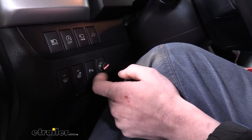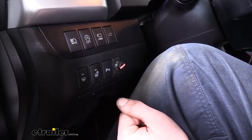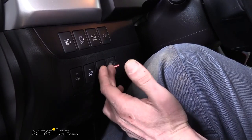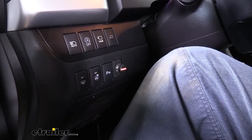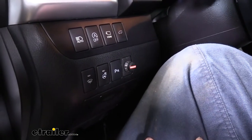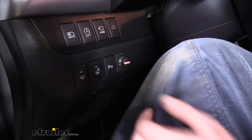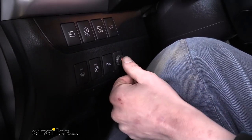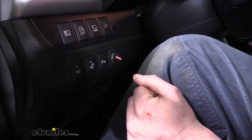It also has a second mode — a user control mode. This is similar to time delay, but it is Redarc's own specialized system. This is more for off-road applications because when you hit the brakes, they're going to apply at the back so you can dig into the mud and stop instead of sliding without really applying the brakes. Proportional is good for when you're on the road — it gives you a nice smooth transition as you stop, and the output is based on the number on the slider. The button can be pushed in, and when you press it, it does a manual activation just like the manual slider on a traditional brake controller.